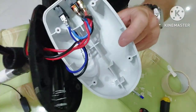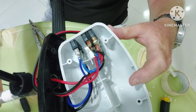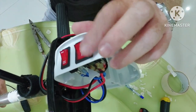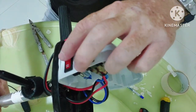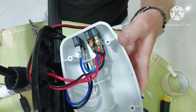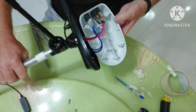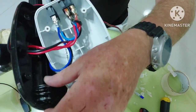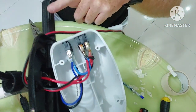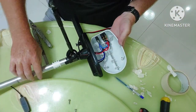I'll double check that everything is pressed down all the way. Take a look inside — there's no capacitor, no fuse, nothing else in there, just the switch for forward, neutral, and reverse, and the speed switch where one is low and two is high. These wires run straight down to the motor and straight to the battery. The spring in there holds firmly — this handle pops down inside — just make sure it's in place before you close it up.